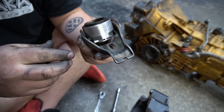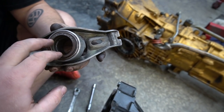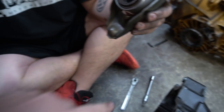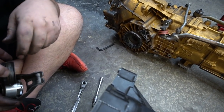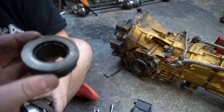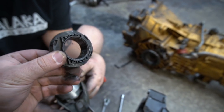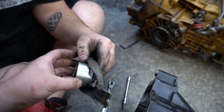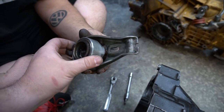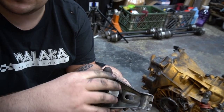We're upgrading to a different throw-out bearing. This is the same throw-out bearing George is running in his carbon setup — the 034 billet throw-out bearing versus the factory one. There's a huge difference in quality. The OEM is good, but it still has plastic and small metal components in it and may be prone to failure. So 034 came out with their billet throw-out bearing. We had a spare since George bought a second one for the carbon setup. Now that Stav is looking to go more competitive, make more serious power, and shift more aggressively, we're throwing the billet unit in.